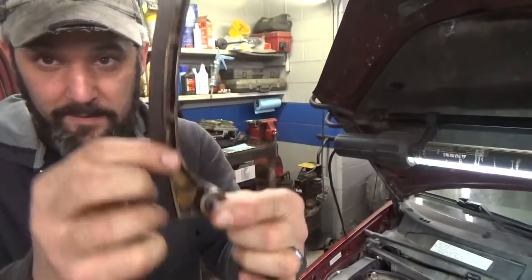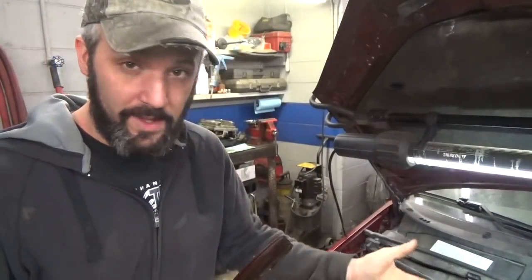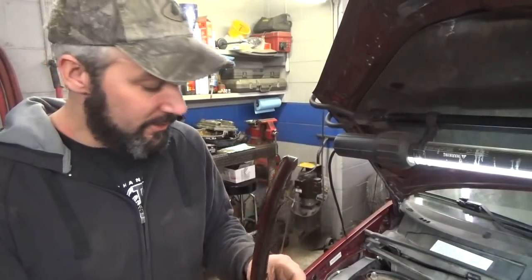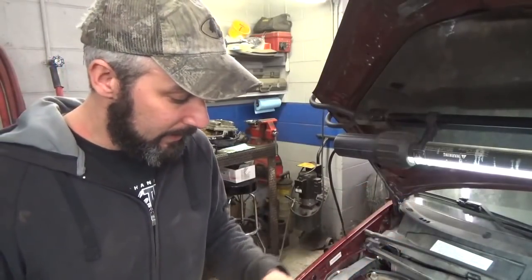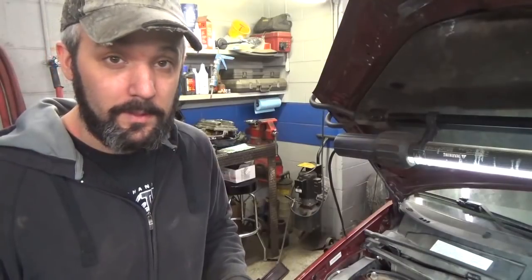Down at the bottom it pivots, and has the tensioner that goes up at the top that holds tension on the slack side of the chain. So I'm going to go underneath, put this on, stick our tensioner back in there, release that, let it hold tension on it, and double check our timing marks, but theoretically we should be in good shape.